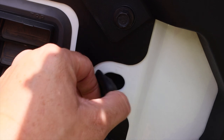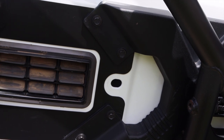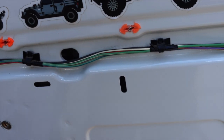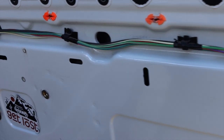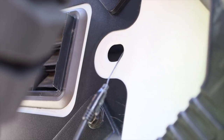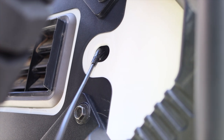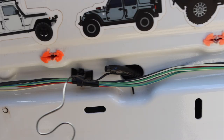Once you install the camera mount on your spare, proceed to route the camera harness into the tailgate. I decided to do this through the seal plug, but you can go through the tailgate door exhauster. After removing the tailgate table, I noticed that the access hole is right above the hole I used to feed the wire harness — this makes the process a lot easier. By drilling a hole large enough to feed the wires tightly through the rubber plug, the chance of leaking water or dust into the tailgate is slim to none. I used a piece of hard wire to fish the wire through. Make sure to also route the red wire found on the harness — you will connect it to the 12-volt wire on the reverse light so you can use the panoramic reverse mode on the full view mirror.